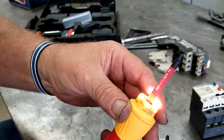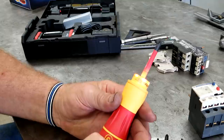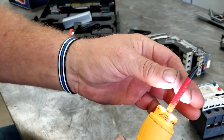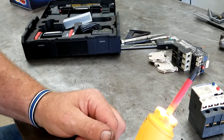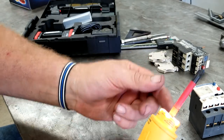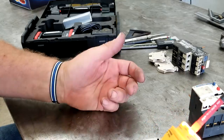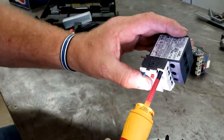On max you get a double blink on startup — it gives you a visual warning saying hey, you're on max, you're risking stripping the screw. On minimum, no blink. They say it's between 0.4 and 1 Newton meters of torque. I'm going to stall it right here — you see the RPM it's spinning, and as soon as I stop it, look at the speed it runs. It's kind of a two-speed thing — as soon as it senses a little bit of resistance, the electronics in there are pretty smart. And that only works in the forward direction; in reverse it doesn't care, because when you're backing out a screw you want as much torque as you can get.